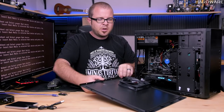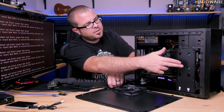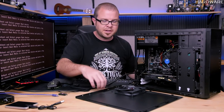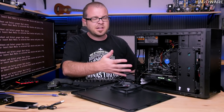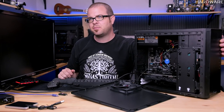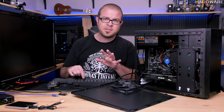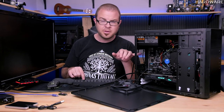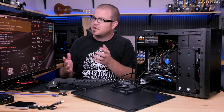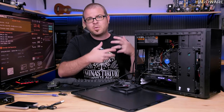Step one is to test everything. We powered it on at the end of the build and saw fans spinning — the side fan, the front fan, and the power supply fan. Some newer graphics cards only spin their fans when the card gets warm enough, so that's okay. For additional checks, we need to access the UEFI, also known as BIOS. Right after you power on, just start tapping the Delete key — it's almost always Delete on modern motherboards — and that will take you into the UEFI.